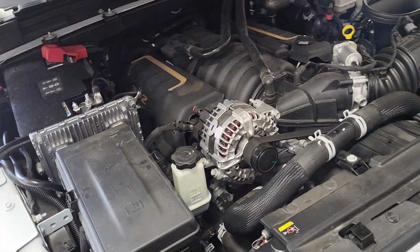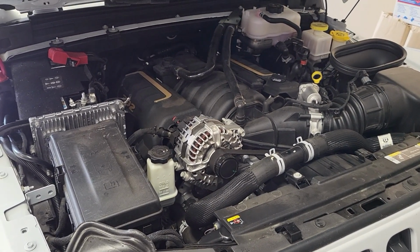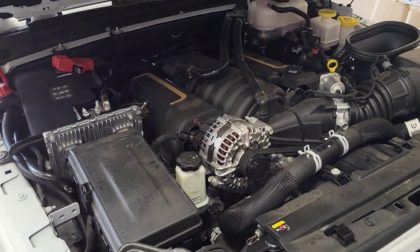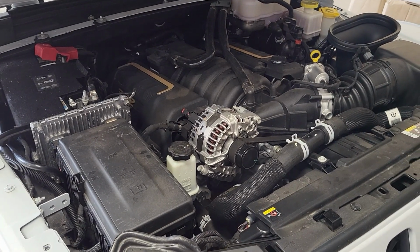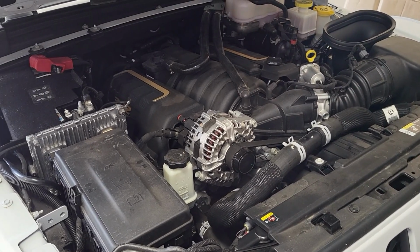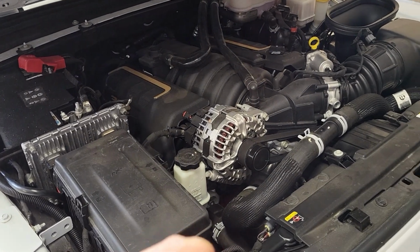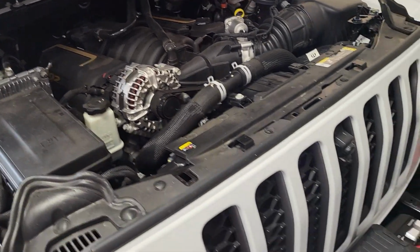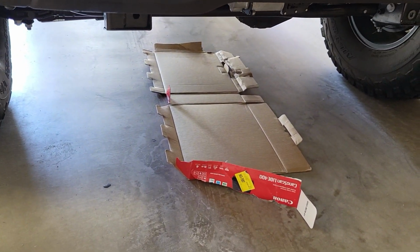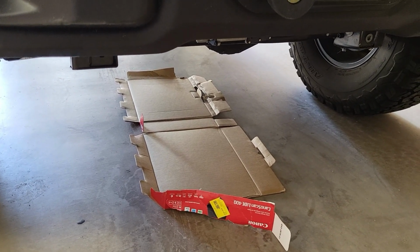So you're finished. And remember, I do 3 things differently. Number 1, at the end of a drain, I flush with half a liter of fresh oil, pushing it all out at a final drain. Number 2, I not only lubricate the new oil filter's gasket, but I also lubricate the rings for the threads on the inner spindle. And number 3, I also let it sit overnight and inspect for a clean sheet underneath with no drops. Thank you very much. That's how I do a 392XR oil change.